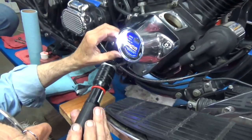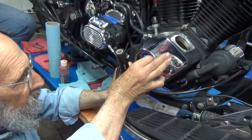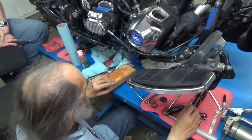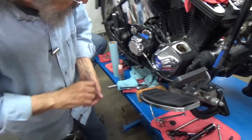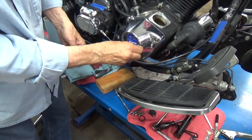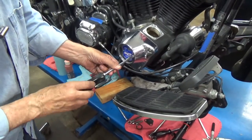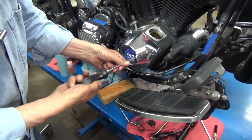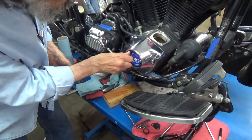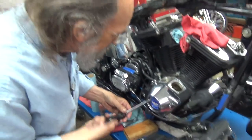I think I've made a mark in there before — like right about there. Let's see if I got the screws for it. We'll put those in and we'll leave the cover off until we get it done. I got a screwdriver for it. We'll put it in all the way and then back it out so we can adjust the timing for our initial setting. It's real important to do that carefully because otherwise you can cut through that insulation.